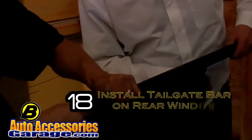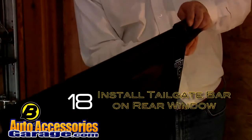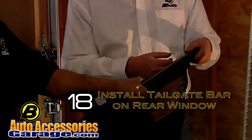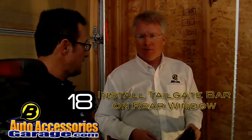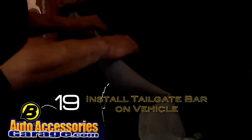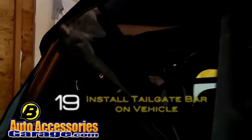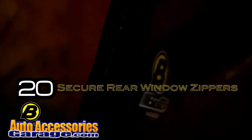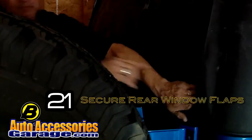So there's a little channel at the bottom of this back window that just slides right into the tailgate bar. And obviously we're doing this upside down. And what I'm doing is checking the length from this corner to this corner. It's pretty even. So then I'm going to install it on here. Now we're going to just zip it right in. That little plastic piece right there on the rear glass just goes right into that belt rail.